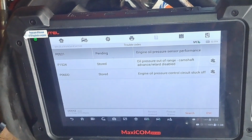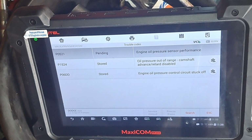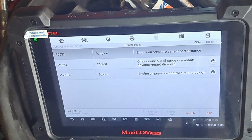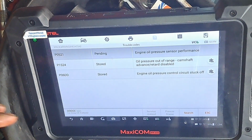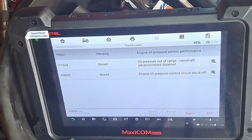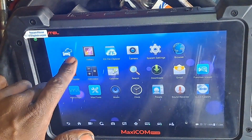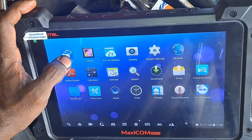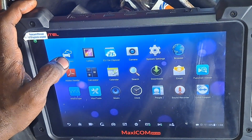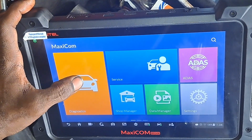So I had signs of metal flakes in the oil filter. I put a new oil filter in it, and it helped a little bit, but we know for a fact when I pulled that pan down, our primary problem was simply an obstruction. And if it was my car, I probably would have tried just cleaning the strainer, but it was pretty difficult cleaning that strainer, especially what was in there.